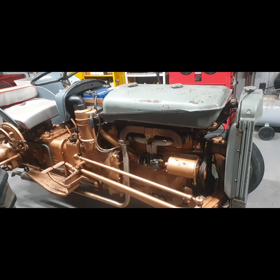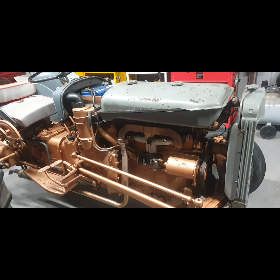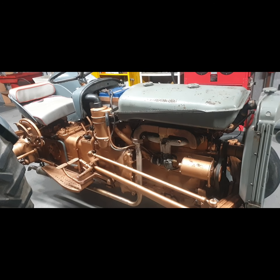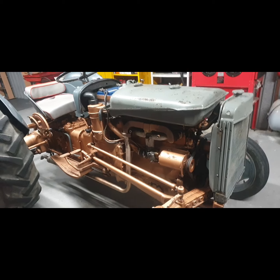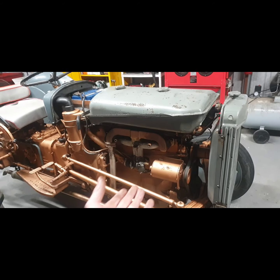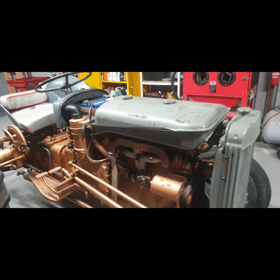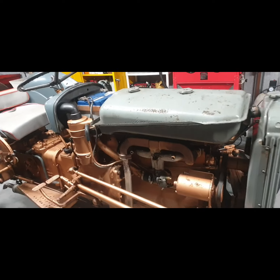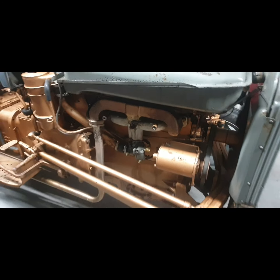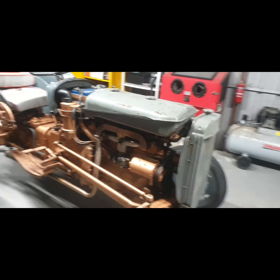It should seal with the new valve, and I played around with the aluminium washers to get the right length. We'll know when the engine is asked to work — if the float level's too low it'll start labouring, if too high I'll need to adjust. I left the idle jet lean on the tick-over and haven't touched the main jet in months — it's only ever been the idle jet I've messed with. Hoping I can call that a job well done, but I won't know for a while.